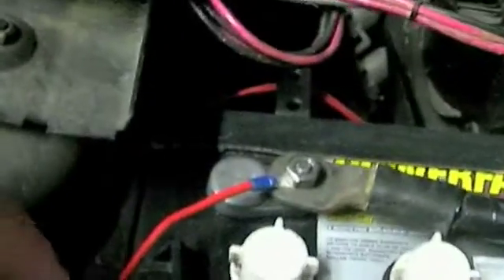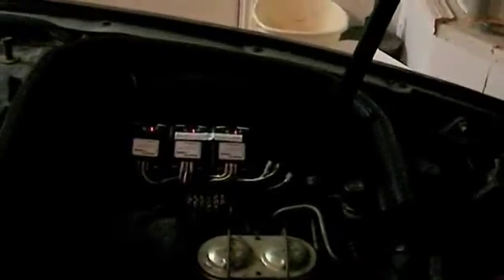I have a handful set in the back for the back half of the battery pack. You can see here's a little tap for the batteries tapped for the power check modules, and I do come right off a fuse — it's very important to have that fuse very close to the batteries, just in case you cross any lines at the other end, it will blow that fuse right at the battery terminal. Up front there are fewer batteries, so I have fewer modules — only two are really working and shuttling power; the last one is just sitting there waiting. This one also has little taps on the battery with the fuse very close, shuttling the power back and forth, creating a balanced battery pack.